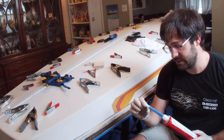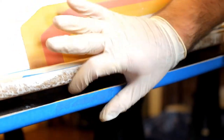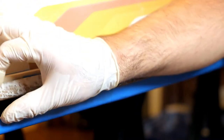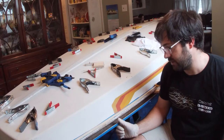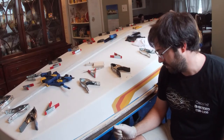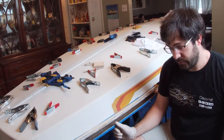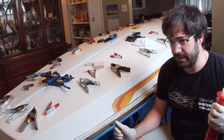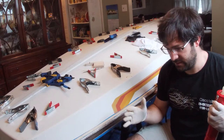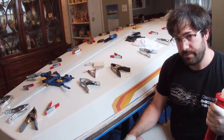I've cut a couple of these tips to get the bead width right. I'm going to put the first bead just along the bottom so that when we squeeze the pieces together we'll get a good fill in there, and a second smaller bead around the outer edge to make sure those two edges stick together really well. I'd like to err on the side of having too much rather than too little — if there's a lot of squeeze out I'll deal with cleaning that up. The last repair was definitely starved for material. It's going to be a bit of a race — I'd like to get around the whole boat and get everything clamped in half an hour, though 40 to 50 minutes is probably more realistic. The work life is about 50 minutes at 72 degrees, which is about what it is here.